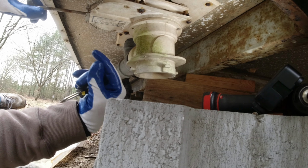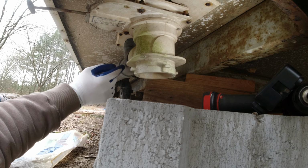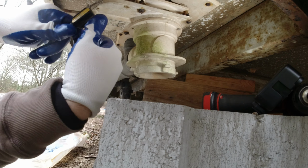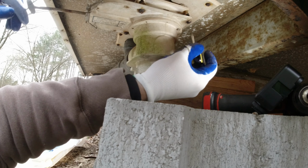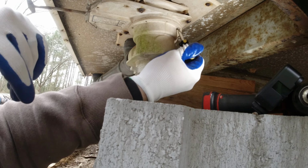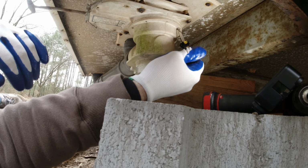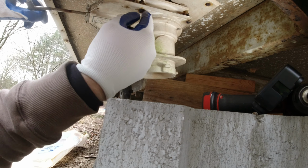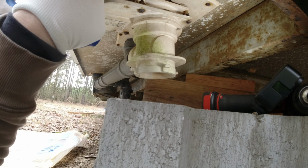Okay, so we're under here on this waste valve system. This is the line that's bringing all the gray water in, and it's a 2-inch line that comes into this side. I really don't want to get into all that. I just want to replace this part of it. And it looks like you have this screw here, which I've been trying to get out. Stuck in there pretty good. And you have these completely rusted over bolts, and the rust has since busted the plastic out.